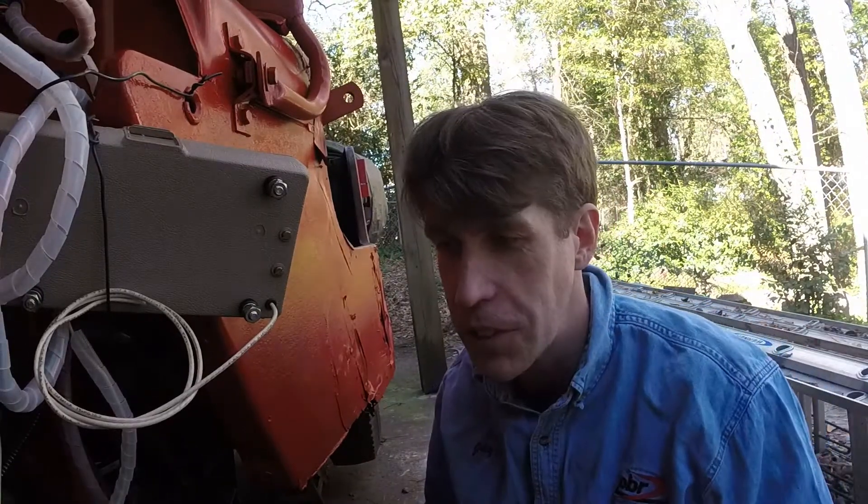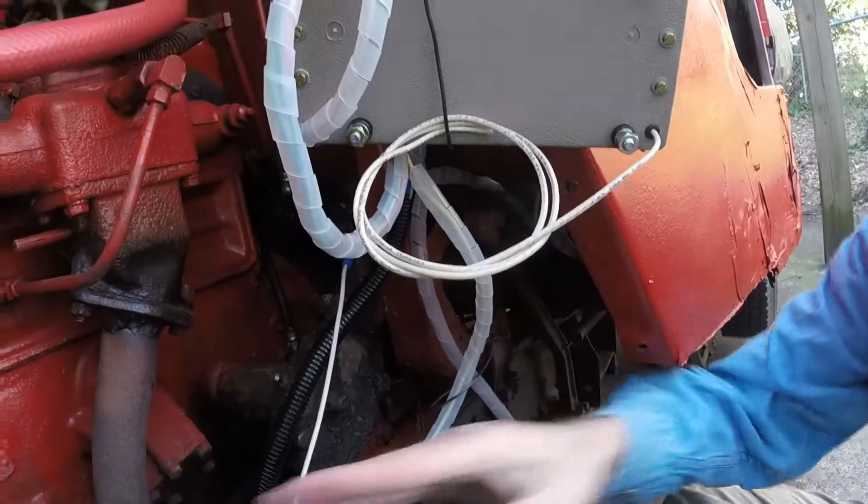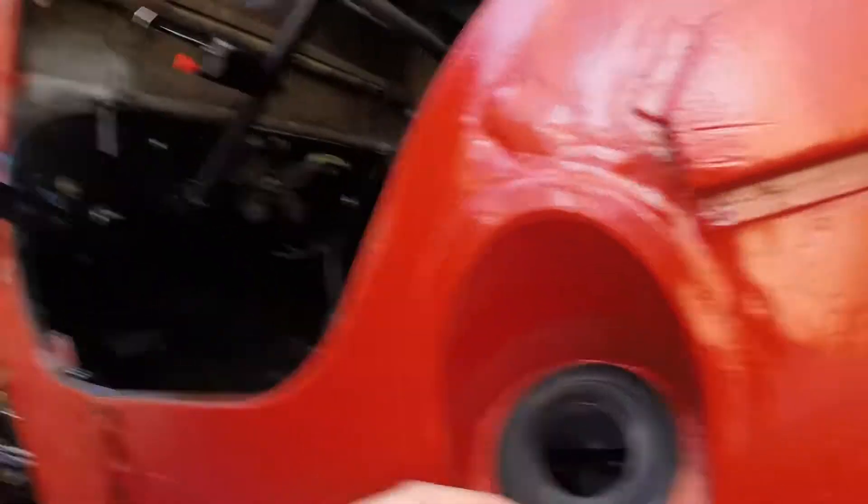I'm fishing this hard line through by starting it from underneath, feeding the front end until it kind of hits the steering knuckle, then feeding it through this hole here and bringing it back around to where it needs to be. A few tips before putting the fuel tank in: I put a little dielectric grease on the rubber grommet to help put the fuel spout through, and then we're going to use what I call the awkward dance method — just kind of wiggling it in there to get it to seat into where it needs to in the pan.